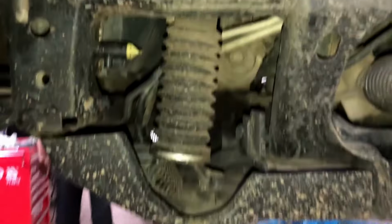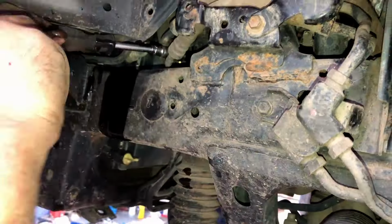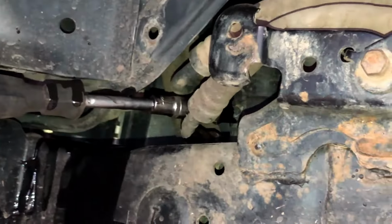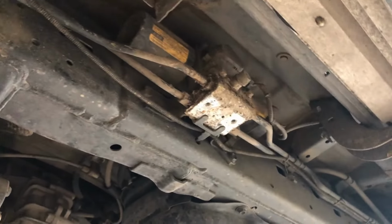But the hydraulics are all in place. Since we decided to install regular stabilizers, we are removing everything related to the KDSS system without regret, as it will interfere in some areas. We release the pressure in the hydraulics and remove the hydraulic cylinders. Next, the valve block with the hydraulic accumulators is removed, and then the tubes will follow.